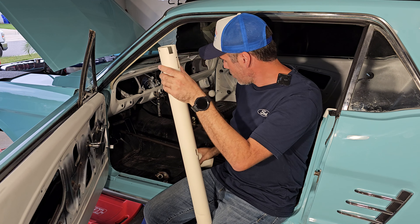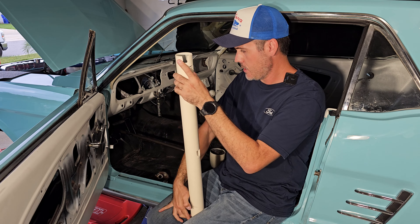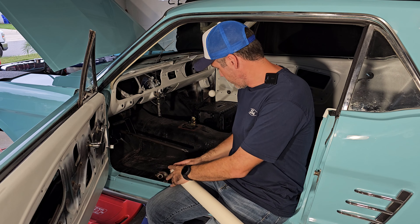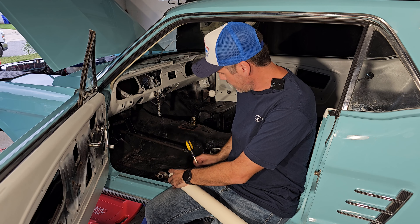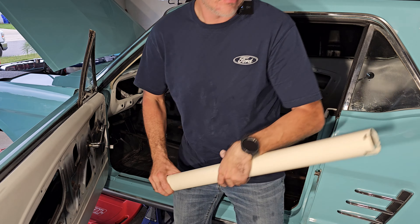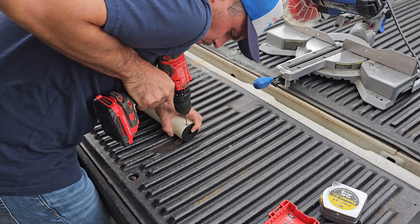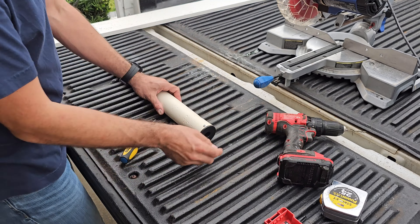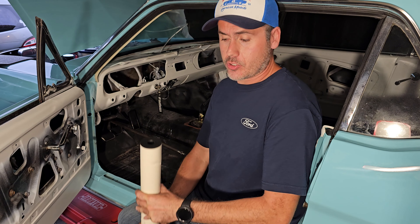All right, we got the steering column already cut — nice cut! This is the cap I was talking about, the one that goes in the bottom to keep the shaft centered. We also need to drill a hole and add a small screw to keep this cap in place. Make sure that screw is facing up so you can remove it easily if you need to remove the whole system in the future.